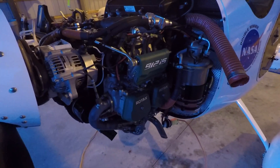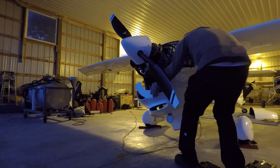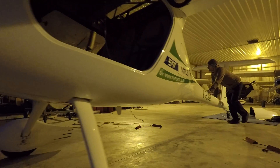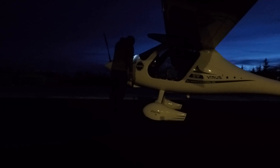I'm back to finish the annual 100-hour inspection. I just torqued up the new spark plugs to 20 newton meters and put the caps back on. Now we're just going to put the cowl back on and give it a test run. Good — no leaks.